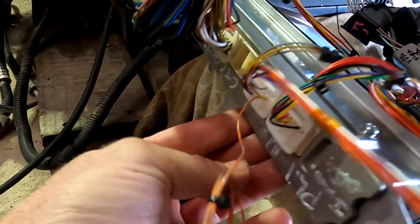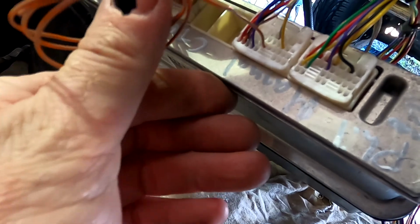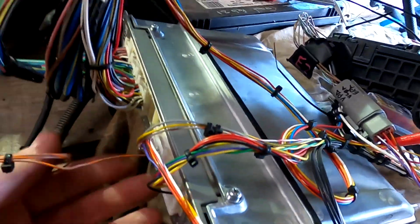Let's test a manual one, shall we? Okay, what have I got here? It says Phil's manual. When we do a 5-speed manual, it needs to see 12 volts to a gear input. With the changes made in the ECU, it eliminates the need for any additional boxes, like a little transmission emulator on the 5-speed 3UZ ECUs. Same thing applies here, no need for an emulator. You don't even need to put any inputs into the ECU for the transmission at all. You just take all the transmission wires out and throw them away.